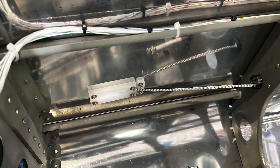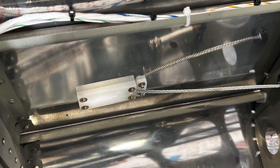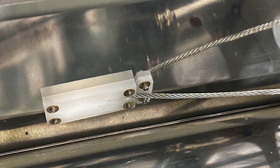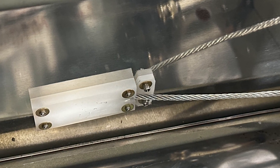And then the rudder cables — they go through. Now you get to start riveting on plastic pieces. It felt a bit awkward in the plastic because it felt really tight. But tight's better than loose. The whole purpose of the plastic is where the rudder cable goes through the slit in the back so it doesn't rub against the metal. It's not structural, but it's going to keep the plane flying for a long time.